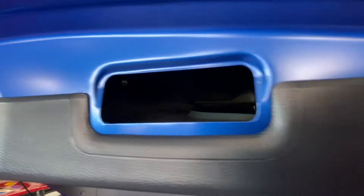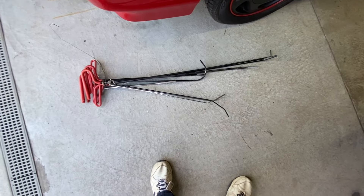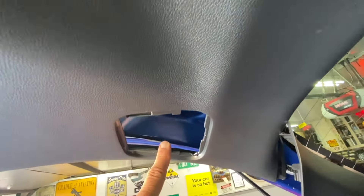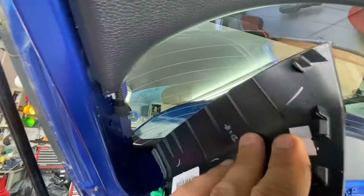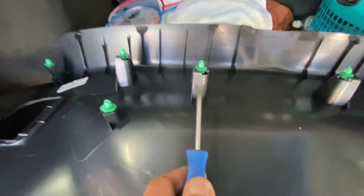I wish there was another one over here, but no such luck. We'll see what we can do. We have our implements of destruction that I bought years ago but never mastered. So we're going to learn today. We are also going to remove this whole inner panel. These little covers over here to get to the lights — they pop out. Everything is attached with little green clips. We pry this one out because it latches into the top. Same thing on this side. We have all of these popped free, and if you look inside, there are a few more deep in there holding the top on. We're going to slowly work our way to get these all off. Once you pry this end down, you can come in with a little tool, stick your arm in, and pop the rest of these free — and the whole thing will come right off.